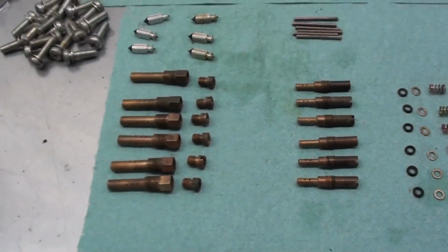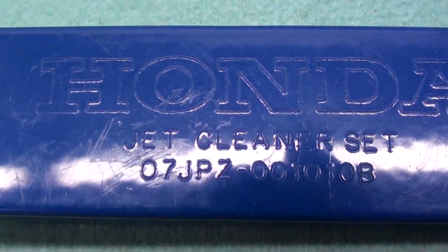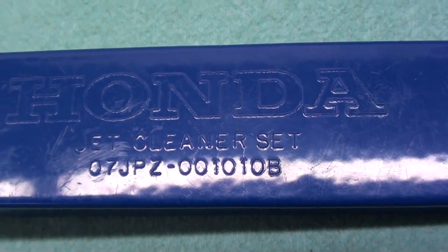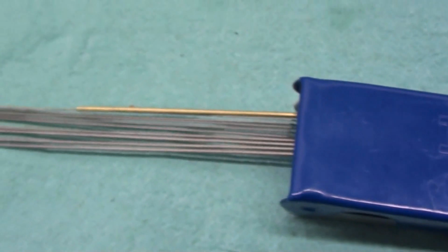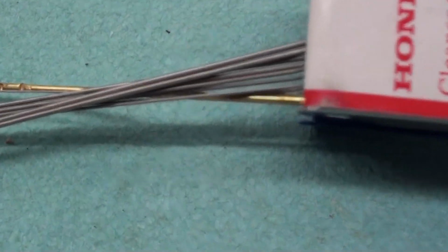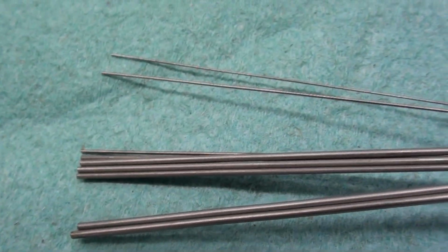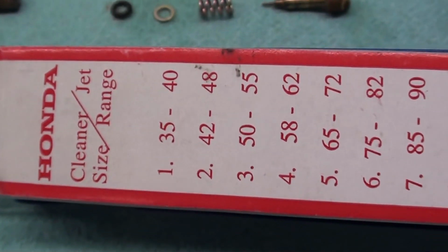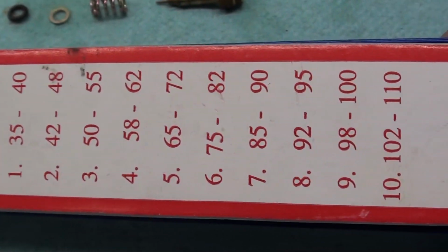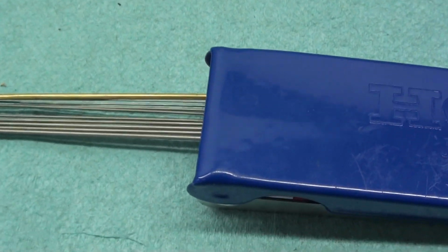One other thing that I like to do with my carburetor jets, this is a special tool I keep in my toolbox. This is a Honda jet cleaner set. Now I'll put the part number down in the description there if you're interested in getting one. And basically this is a set of indexed wires of different gauges that are specifically designed for cleaning carburetor jets. And as a matter of fact, they put a little range there on the back of it to tell you which number jet cleaner is designed for which particular jets you're working on.